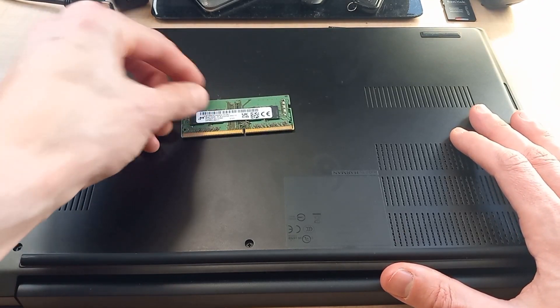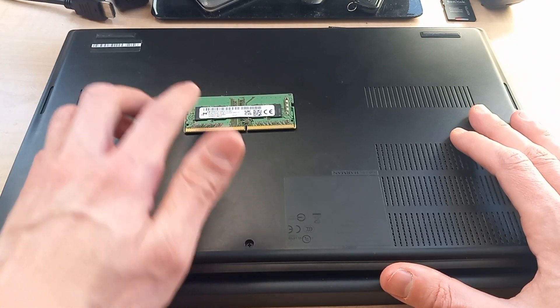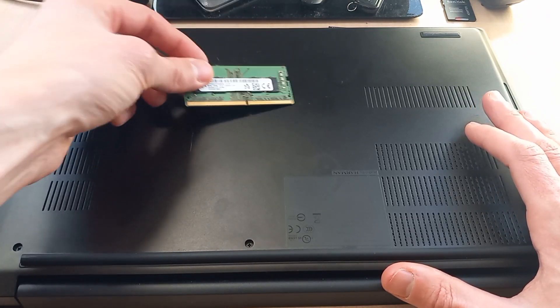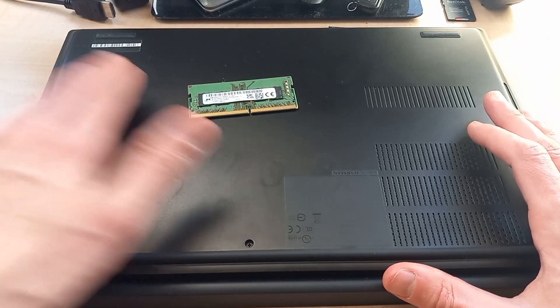So that's what we're going to do. We have an 8GB RAM module — that's DDR4, and obviously it's a SODIMM because it's a laptop. We're going to install that to bump up the RAM from 8GB on the inside of this device to 16GB total.